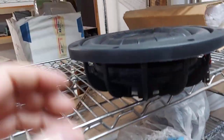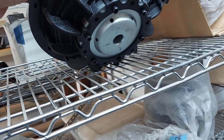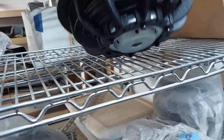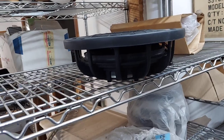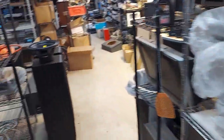This was a sample I got — I found out Kicker actually makes a version of this. It's a shallow sample, single 2-ohm. I think we'll do a hundred bucks shipped on that one if you guys need a shallow 10. The specs are pretty good — it only moves about that much before it starts leaving the gap, they didn't really give themselves much room to work with.